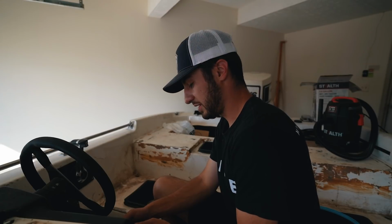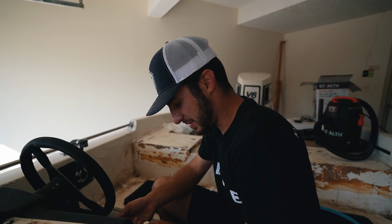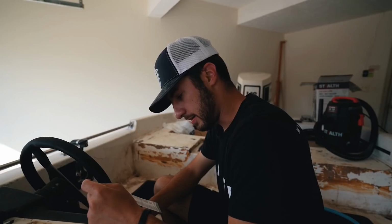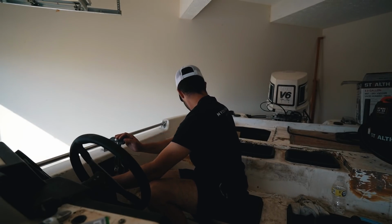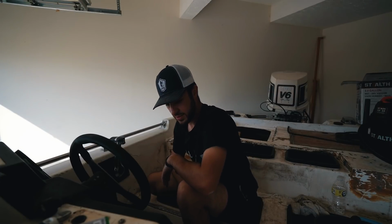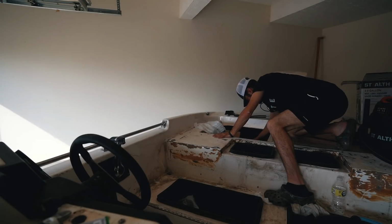Well, she's doing nothing. That's depressing. Super anticlimactic. So either A, I did something wrong, or B, it doesn't work, or this is incorrect. I followed the diagram, but all right, back to the drawing board. Trim's not working anymore, the jack plate's not working, so either the battery's not making a connection, or I popped a fuse trying to start it, which I'm assuming means I hooked it up wrong. Crud. Positive and negative.